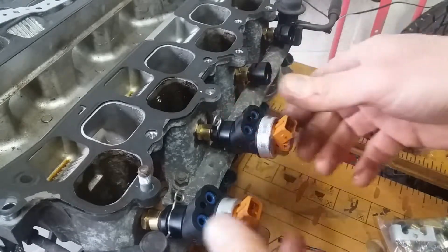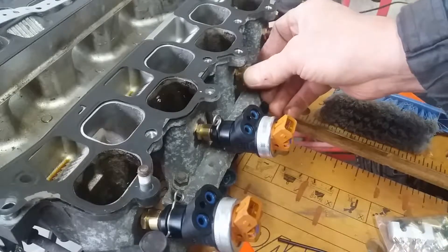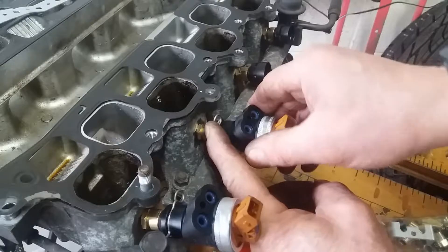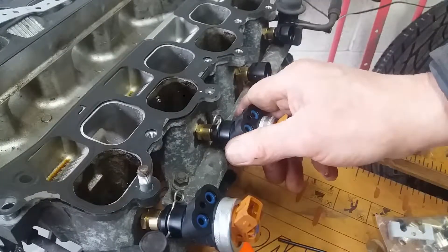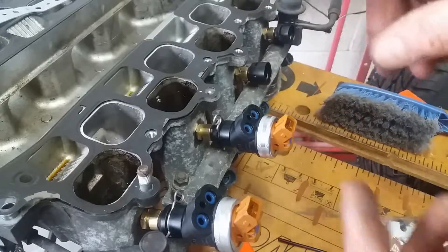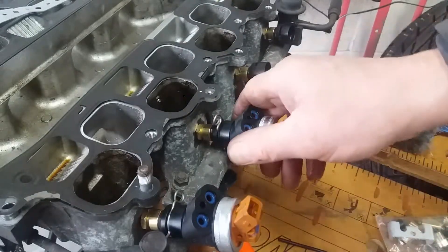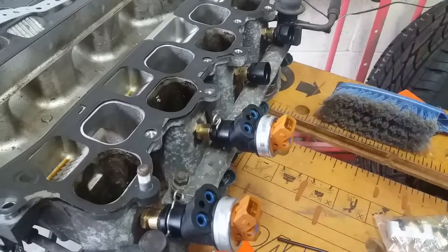Something I've just noticed is that you can unscrew these — they're just pushed into place with little brass ferrules. But once the injector's in, if you hold it in situ, you can actually rotate it to orientate it in the correct position. There's a guide as to how many degrees of vertical. They generally say they shouldn't be pointing up — they've got to be pointing anywhere from zero degrees pointing straight down to 90 degrees on the horizontal. So that's two of them in.